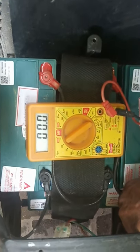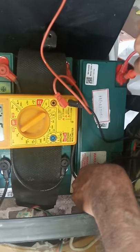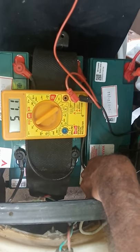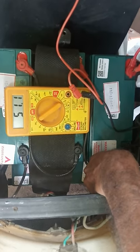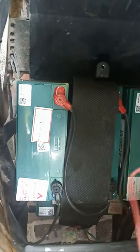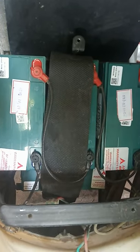Now I have started to test the total voltage from end to end. You can see it is 51.1 volts — a series of 4 batteries. When fully charged it can go up to 53V, but generally it is around 51V in series. Now I am going to place an insulator here as it was earlier. There is a bracket which has to be placed — I have cleaned this bracket, it was full of dust.